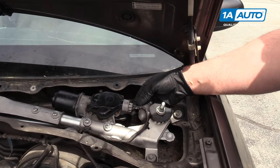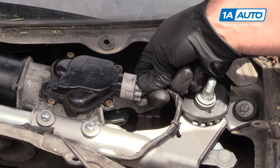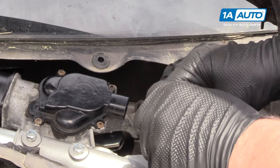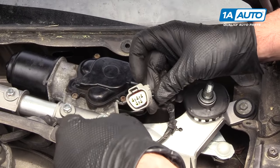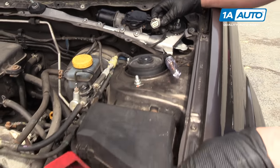So we're going to disconnect the connector. Remember, keep your hands clear of any mechanical moving parts. Disconnect that. Okay, so here's your electrical connector. We're going to test it with the test light. We have our test light on ground.